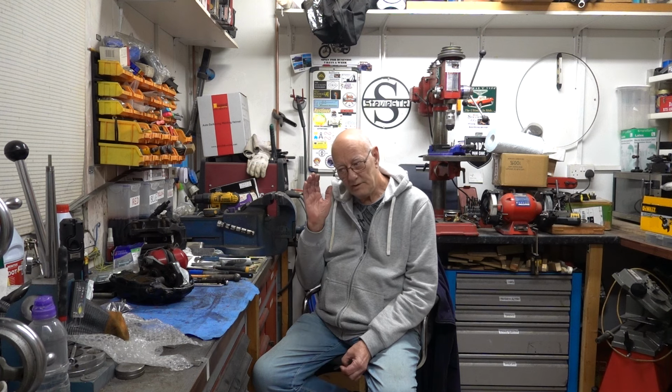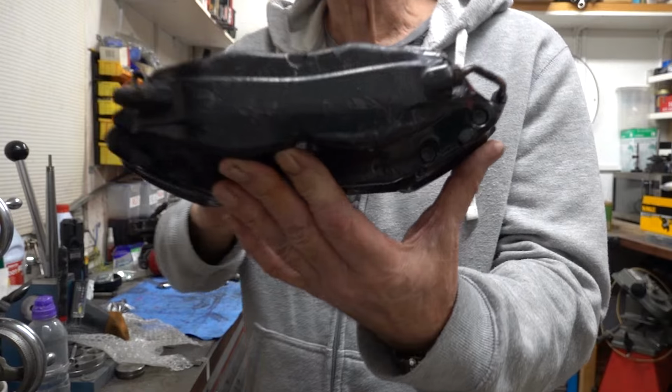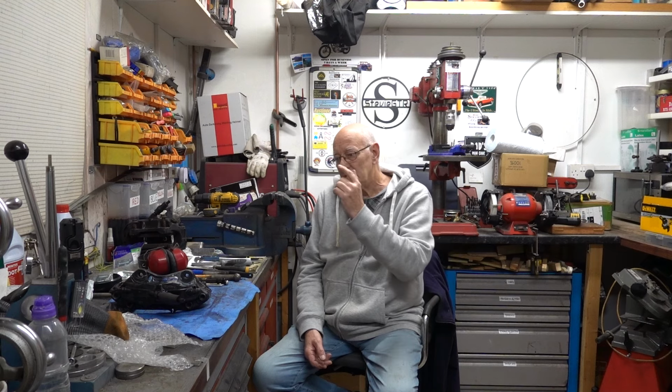I've maybe said before, and I'll probably say it many times through this video, that the only kits I know of that you can buy using the E38 BMW big 4-pot massive calipers, these great big things, is not that hard to do, but the carrier for the caliper on the TVR, which I'm assuming is a Ford Sierra or something, the centres on the lugs, on the castings, on the hub aren't big enough, because these are much further apart, so I've got to make some adapters.